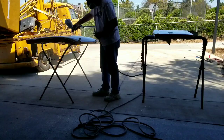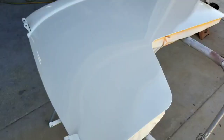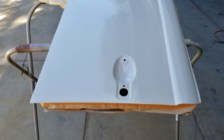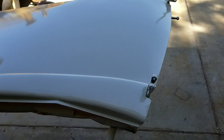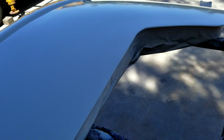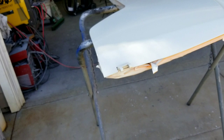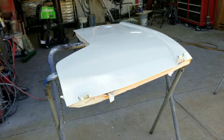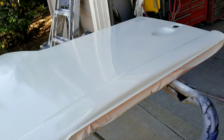Let's take a look at them with the sealer here — just the sealer. There are a few little waves in them but not much. Like I said, it's a van. I'm not trying to get it perfect. There's a little one down at the bottom. Once the door's upright and on the car, it's going to look different — you won't notice a lot of it. This one has a slow mover right in the middle. I felt it, I knew it was there. I'm not longboarding this stuff. When it's all done, you'll see it'll look really nice, just like my other ones. I did this the same way I do all the ones I've owned, and people all thought they were super cherry and they're not. Anyway, that's the sealer — I'll let that sit for about 30 minutes or so.